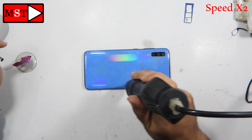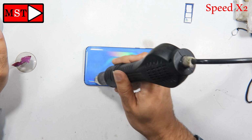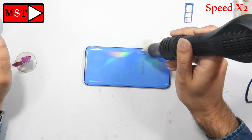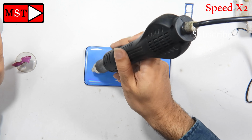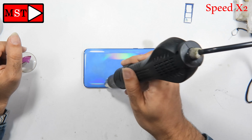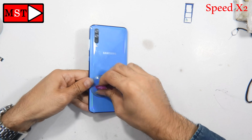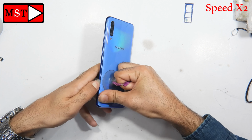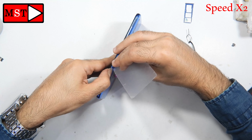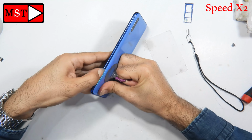The first thing you must do is not press anything on the phone, not put it on the charger, and not try to power it on. If it's turned off, leave it turned off and then go to the repair shop. In this way, he can open the device and clean the water. Don't put the phone under the light or the sun. This could make the water turn into corrosion, and this will cause shorts on your device and burn something.